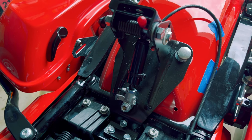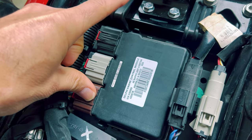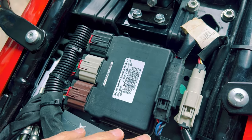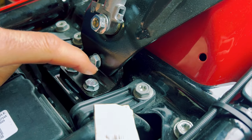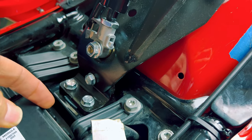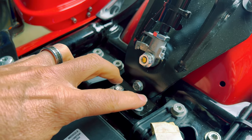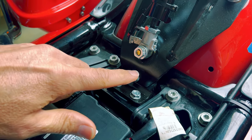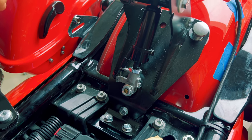As you start this process, you will first come over and pull out the little clip on the side — there's one on each side — so you can pull this up out of the way. You don't have to disconnect it, just pull it up out of the way. Then this bracket is separate from the main. You put the bracket down, put your two bolts through. You'll be able to reach underneath here once you pull this off and start the nuts on by hand. You can just leave them on there loose — you don't want to tighten them down until you get everything started, then tighten it all down at the same time.